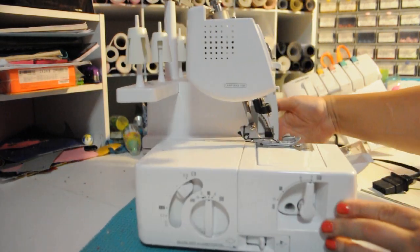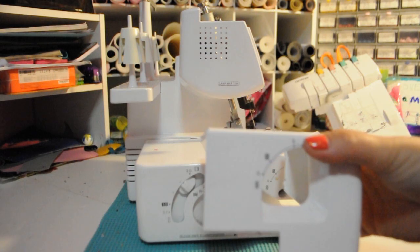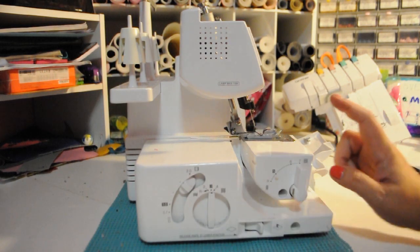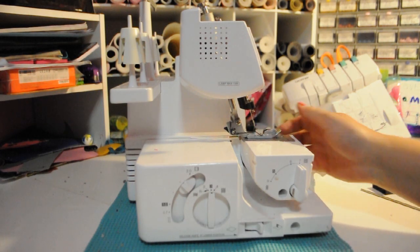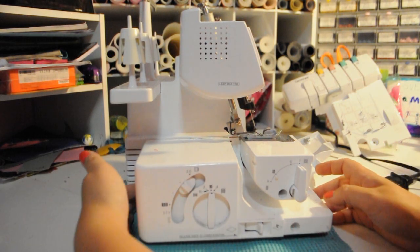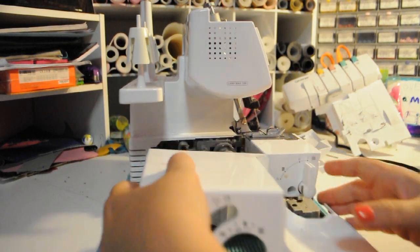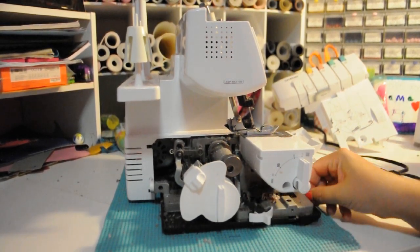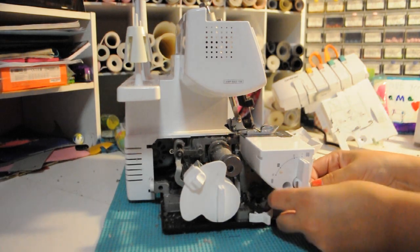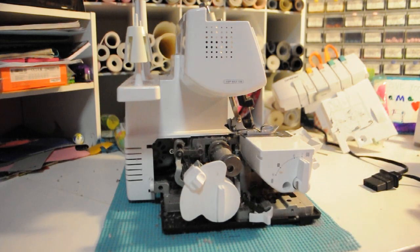We're going to turn the machine — now we're looking at the side panel. This is the arm that comes off so that we can do cuffs, so slip that out of the way. I'm not going to take this portion off today because I can get in there with my canned air from the side. This other portion has a screw here and a screw around the back — you undo those and it takes a little pull to get off. I missed a whole clump of lint in here. If you have tweezers, you can use those to clean it out — they work quite well. So much lint, guys. So much lint.